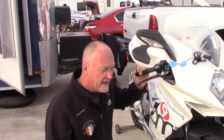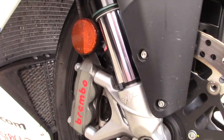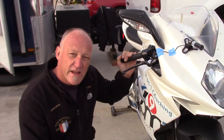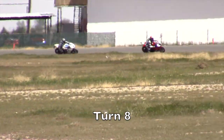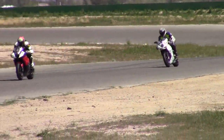With Button Willow settings I completely smashed the fork travel flat. Button Willow is a very heavy braking track, so why did that smash flat here? A lot of it is because of camber - some of the corners are literally like this at 100 miles an hour, so the bike gets absolutely smashed flat, compressed into the corner. Turn one and turn three have cliffs going into them, and because of that you use more travel in the corner than you can generate on the brakes.